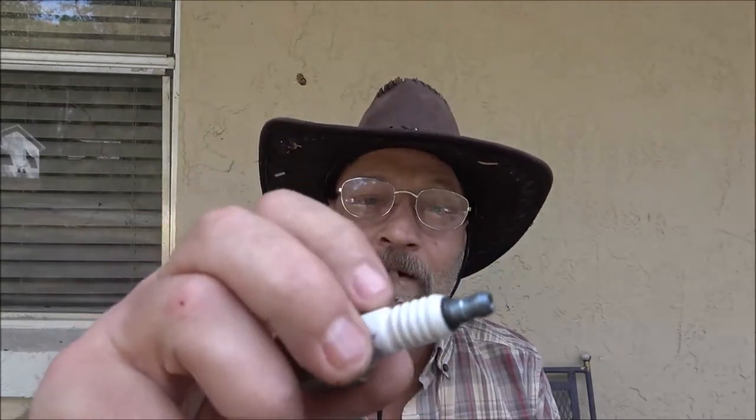What I recommend: if you can clean your plug after doing this by blowing it out using brake cleaner, starting fluid — whatever — blow it out real good with compressed air, I don't see a problem with it. If you're having a problem, I think the problem lies in the plugs because nothing's made like it used to be. I've taken plugs out of the box brand new and had hairline cracks in them — is it from dropping it, or from poor craftsmanship? I've had that happen a lot in the past 10 years.